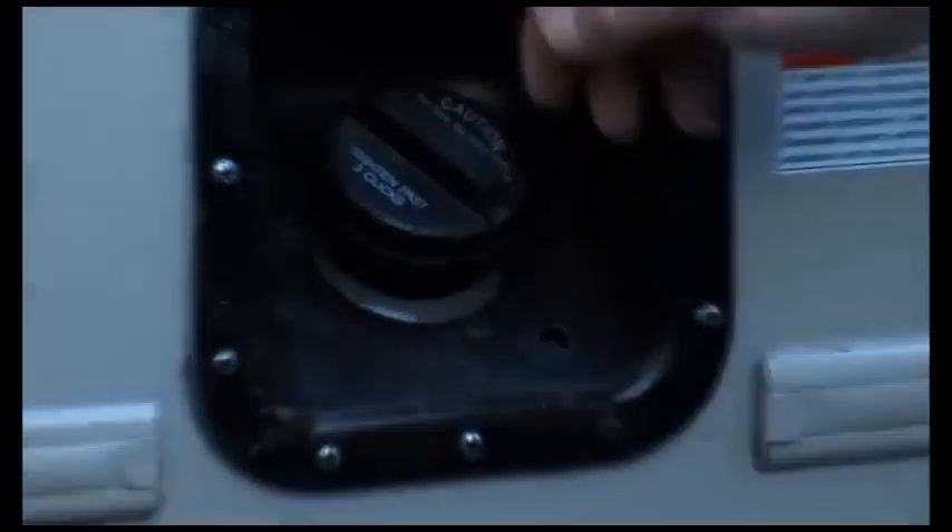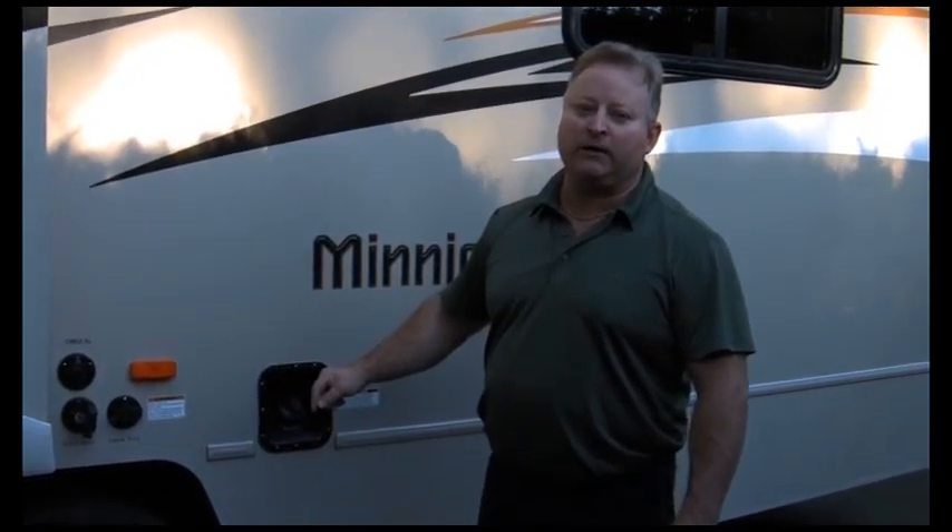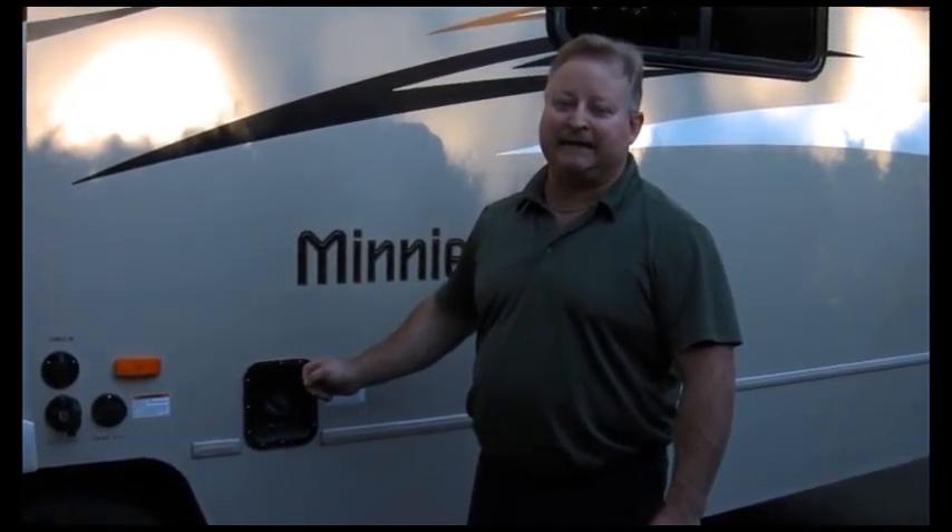Fuel — the thing you need to know about fuel: it's unleaded fuel only. These are not diesel motorhomes. You need to use 87 octane at minimum. If you're doing a mountain pass or towing, you'll get better fuel economy — your RV will like you better with 89 octane or higher. Never, ever, ever use 85 octane that's available in places like California.